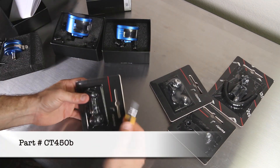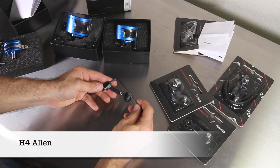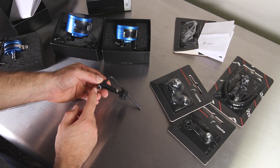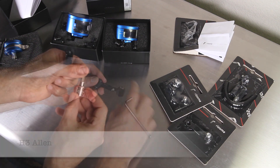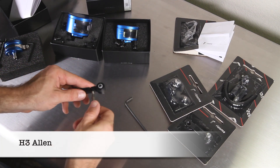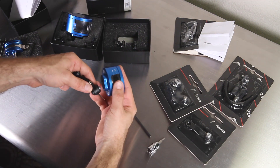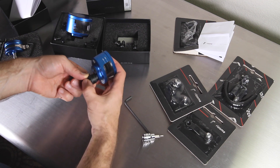This is the CT-450B. It has an H4 Allen head bolt and will mount into any 6mm threaded hole, offering 180 degrees of articulation with the use of an H3 Allen at the joint. This will mount to the bottom of the reservoir and then you can choose the angle that works best for your setup.